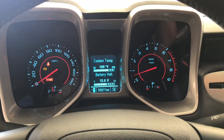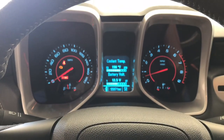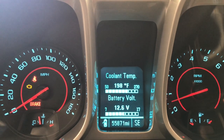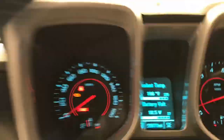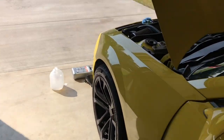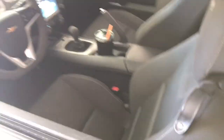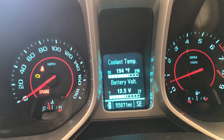So there's that. I'm going to turn the heat off and see where the car temperature goes down to — 196. Let's see if the fans go off. The fans are still going — I don't even know what they shut off at. We're back down to 194 from 220, so just operating how it should be. I'm going to shut the car off but I'll give it a little blip here.